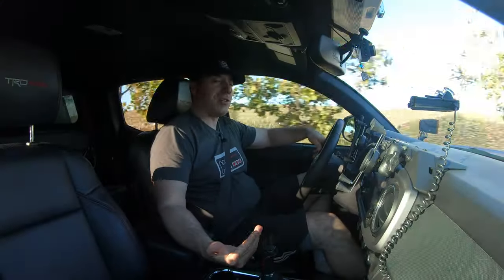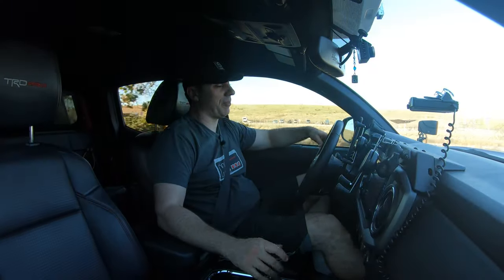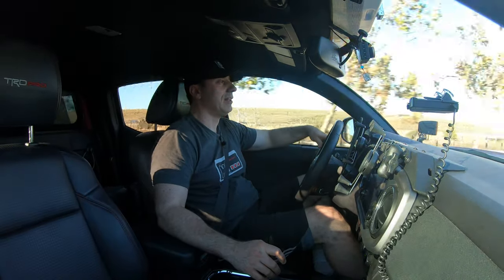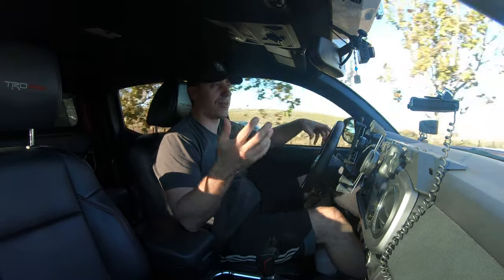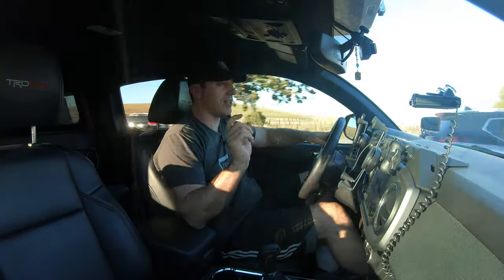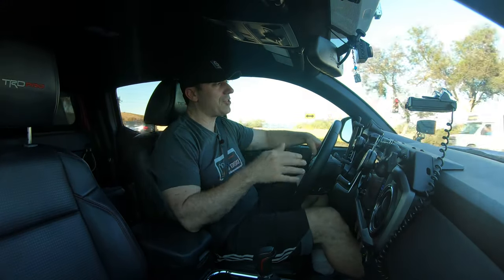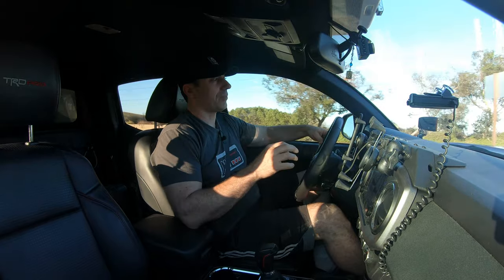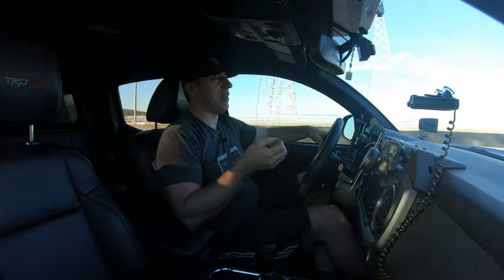One of the things I had to do was, especially because of all the weight I'm adding to the truck, get it regeared. And so I am about 1,000 miles into this 529 regearing that I've done to the truck. And I know there's a huge debate online about 488s versus 529s. I'll give you my thoughts in a second on that. But just in general, 529s, they're great. I mean, I think everybody would agree they're great, but they don't completely transform the truck.